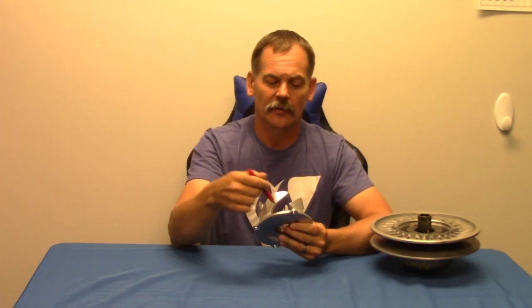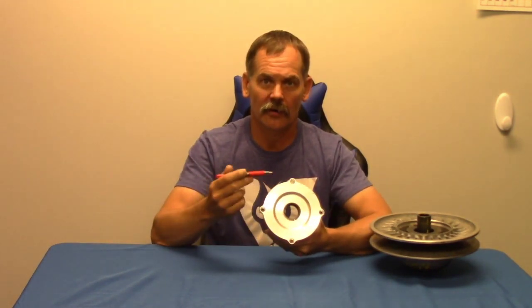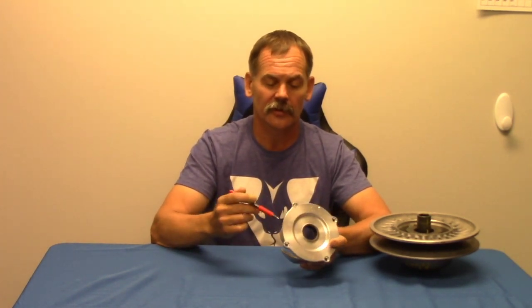If you have a two-stroke snowmobile where the motor runs backwards, it has to lock in low gear, and that's why we put an ER notch in it. So if your helix says ER, it's made for electronic reverse in a two-stroke snowmobile. If you don't have ER, don't try to go in reverse, because it could wreck your belt — it'll just run the belt down to the bottom of the sheave and it won't go anywhere.